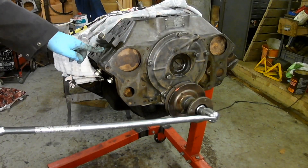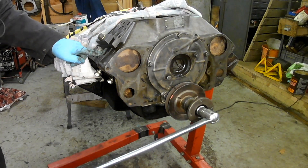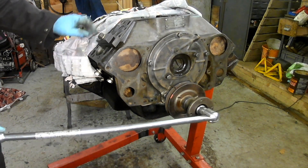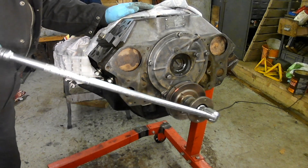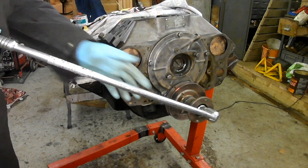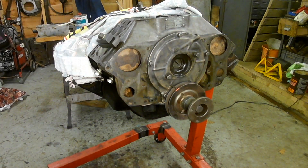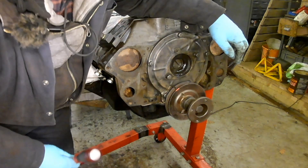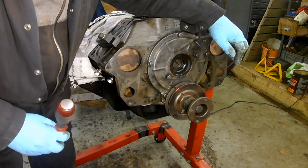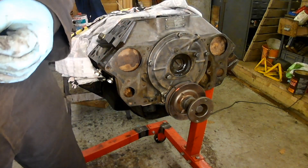So here's my piston. There it is going away. Here it is coming up and I'm going to bring it up till it hits this stop. There - take that off. I've put a bit of a paint mark there, so I've got to put a mark on in line with that.